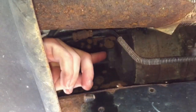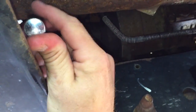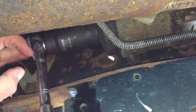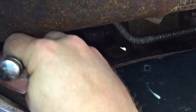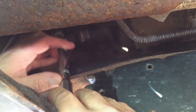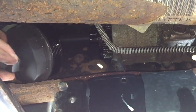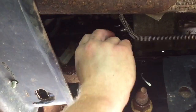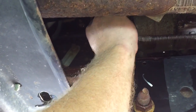Now I can go over to the side where my filter is, which is right here, and that's going to be a 36-millimeter. So I get my 36-millimeter socket and I loosen that up — it's kind of hard to get in there. Once I get that loosened up enough, I can get the rest by hand, and you'll see the cap comes off with a little bit of fuel. The filter stayed in there in this case; sometimes it comes out with the cap, but I can just go ahead and pull the filter out of the housing.